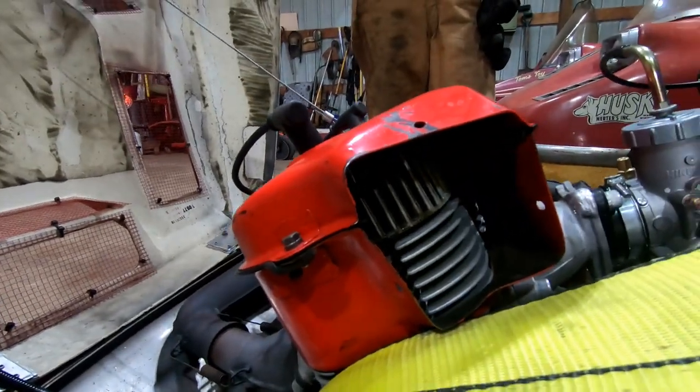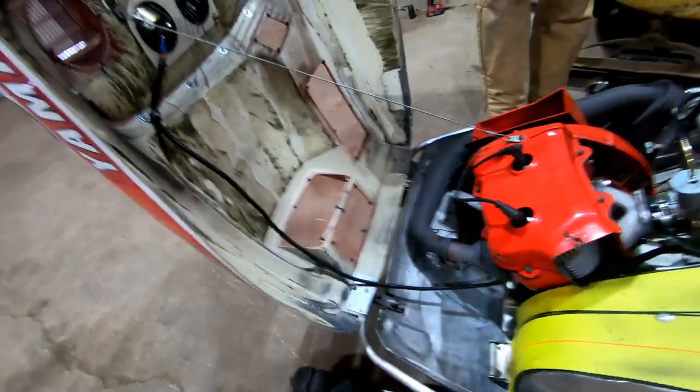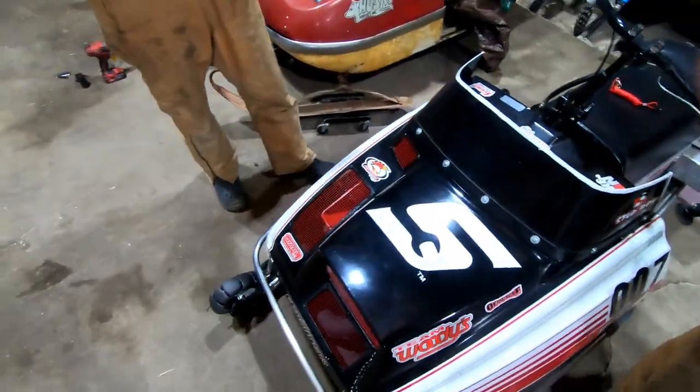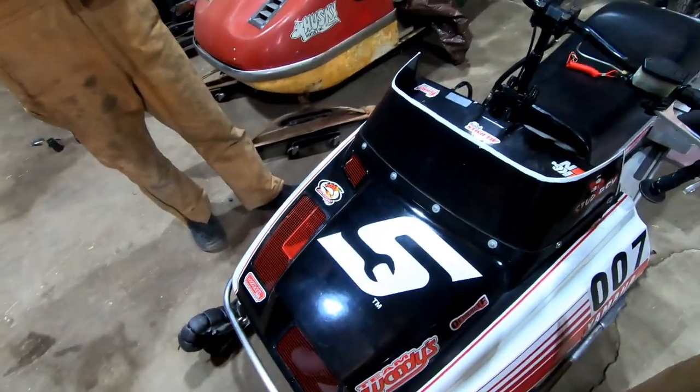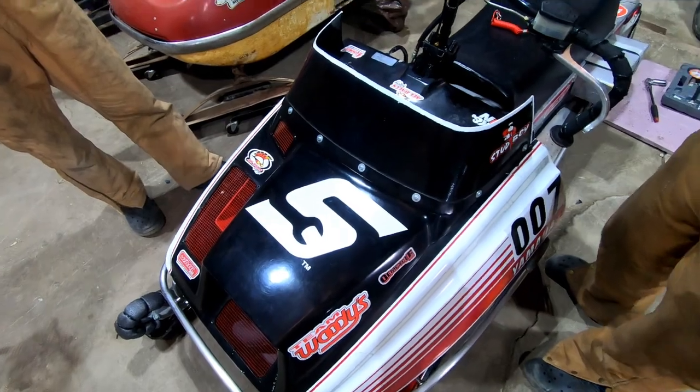Dude, this thing, I highly doubt it. It didn't lean. I don't think you lean seized it. I think you might have blown a head gasket, because this thing was always rich. Yours was the one that was lean. So, right, potentially, guys. I'm going to get copper head gaskets, though. I'll get copper ones. I had the paper ones. Like I said, we've blown them out before. My SRV blew it out an inch wide.